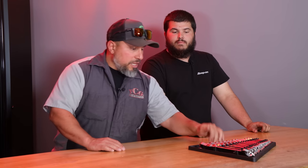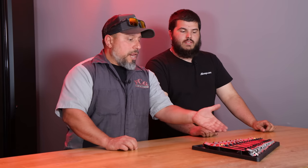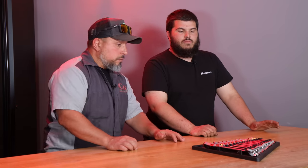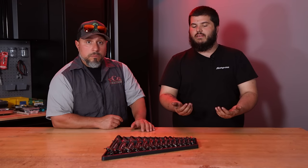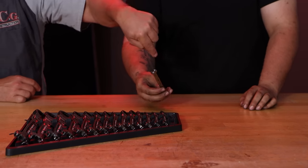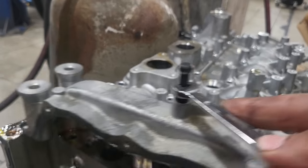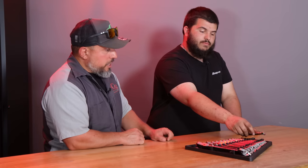What you thought receiving these initially was that these would be an experience like a Craftsman. Yes. So tell us how you used them on the daily. These I used for essentially any and everything. The 8 millimeter came in real handy because on the front of our engines they tend to leak oil. They have E10s which happen to be 8 millimeters — too thin an area to get a ratchet in. So you put a wrench in there, it would fit nice and perfect and just grab onto the E10. I would use the open end to break it loose, because you don't want to damage the ratcheting, and then flip it over and loosen it the rest of the way. It did what I needed.